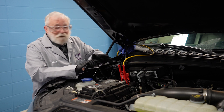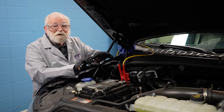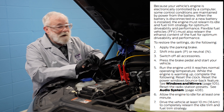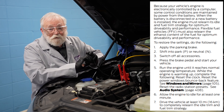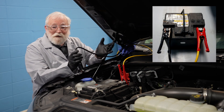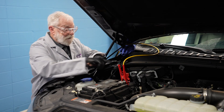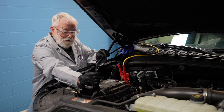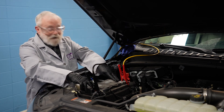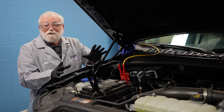This particular vehicle has a lot of computers, and if I disconnect the battery without using something to keep the computers' memories alive, there may be a lot of reset procedures that we'd have to do and might even need some special tools for that. So we like to use a memory saver — in this case it's jumper cables connected to another car battery. I've already got the positive one connected, and now I'm just going to connect the negative one. Now when I disconnect the cables from the battery, the vehicle still has plenty of power to keep all the computers' memories alive and we don't have to worry about any resets.